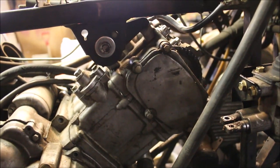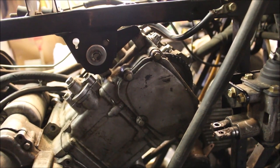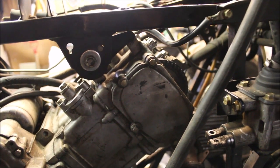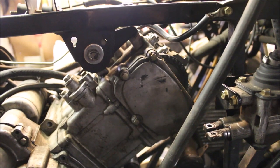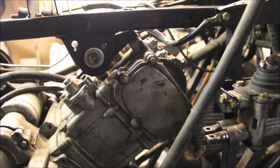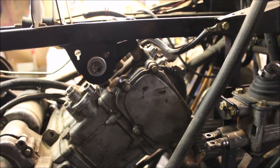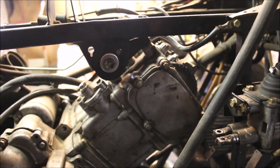It's holding up enough that there isn't coolant going into the piston, but it's blowing back into the coolant, causing the bubbles in the overflow tank. So I'm going to pull that off, inspect it, make sure the head is flat, and put a Polaris brand gasket in. Guys, they're only like $49 if you go on eBay. Spend the money, do it right.